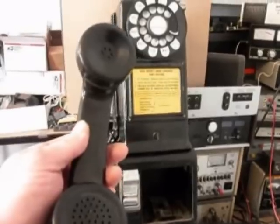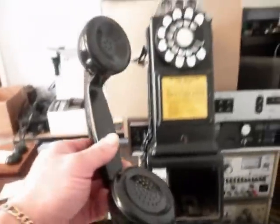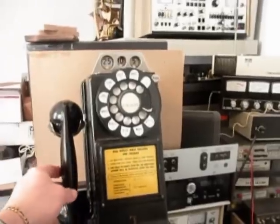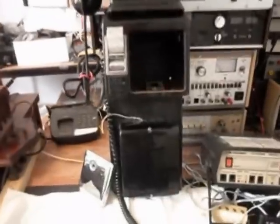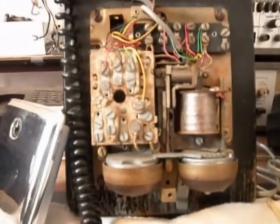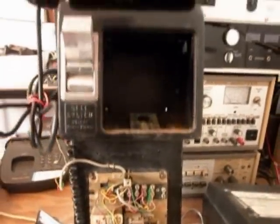What we're going to be doing with this telephone is go ahead and convert it. We're going to get rid of this handset — Brendan has sent along another handset more to the period of this telephone, an F1, so it's going to look really nice with a straight handset cord. We're also going to install a modular port inside the bell, so he can simply plug a line cord in there, and it will run the bell and also feed the phone.